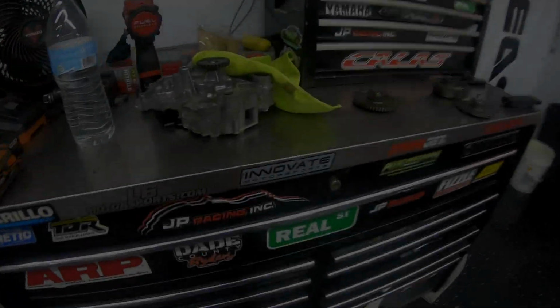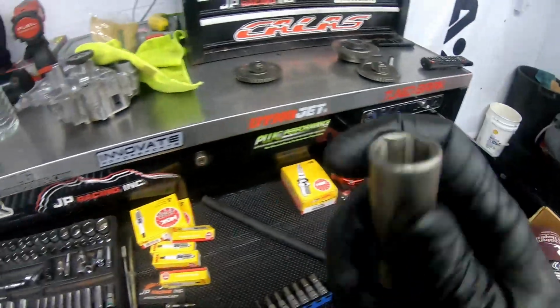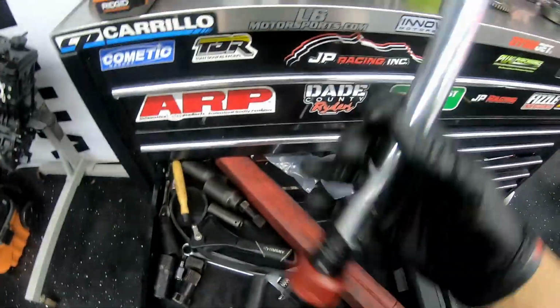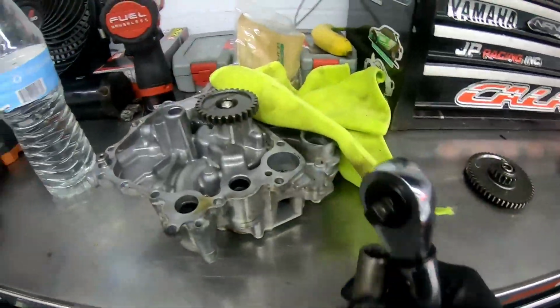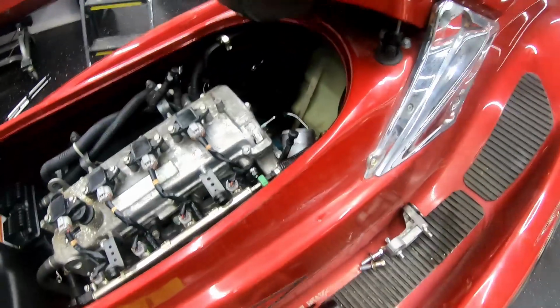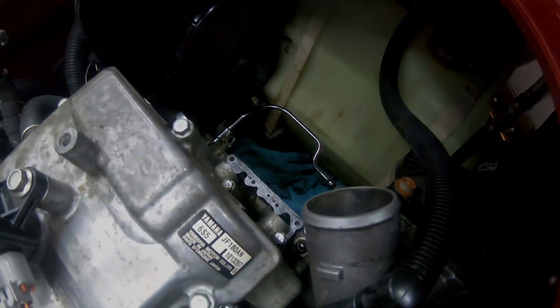So now that that's up there, propped against the wall, we could go ahead and grab the rest of the tools that we need. All right, back at the box, you're gonna need a 17 mil for the socket that holds the clutch on. And I like to use a junk old 3/8 torque wrench just to give me a little bit of leverage. Also, note that this bolt is reverse thread, so righty loosey, lefty tighty.